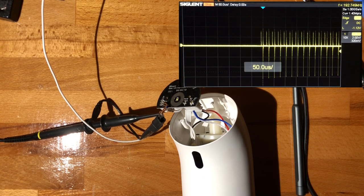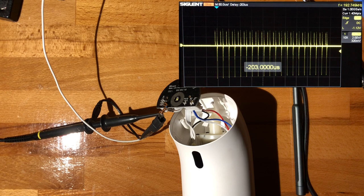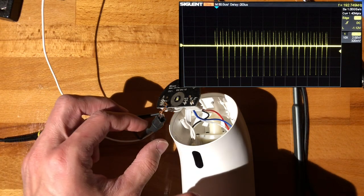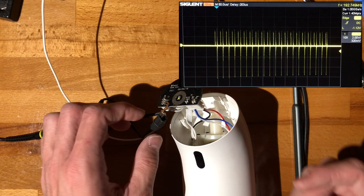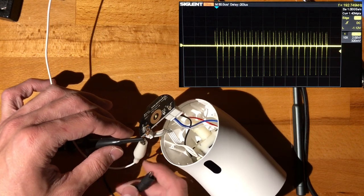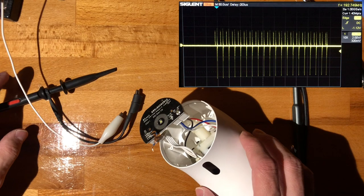All right, so this kind of looks like a series of pulses, which, yeah, I don't know, I've never seen anything like this. I don't know exactly what and why this is like that, but they're driving the LED quite weirdly. So let's actually probe the receiving end and see if it actually changes depending on how close we are to the sensor. I mean, that still doesn't tell us anything specific. It could just be outside of the bounds of its detection. But, yeah. It didn't seem to react in any way when we came close, right? So it was still driving the LED as if nothing happened.